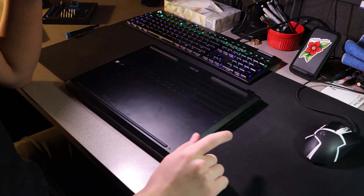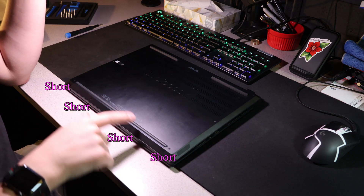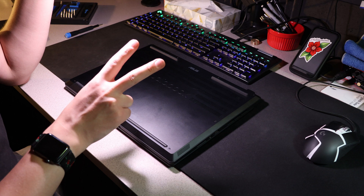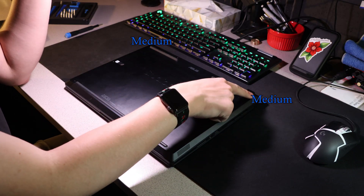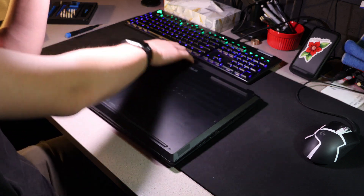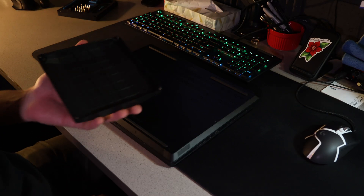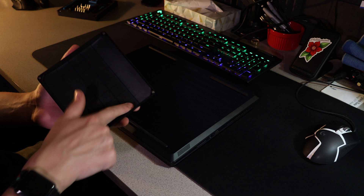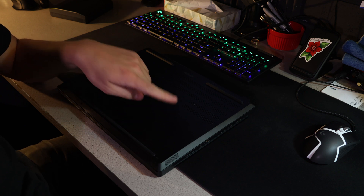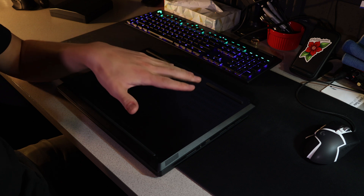I'm not going to take mine apart right now, but for the screws: these are the short screws, these are the long screws, and there are two medium screws that are about one millimeter shorter — those are the corner ones. The trackpad is about here, the back of the laptop is up here. These screws are all really pretty small, so make sure you don't lose them. Use the iFixit screw tray in your kit lid. A while ago I put a second M.2 drive in here and had a pretty hard time getting it open the first time.